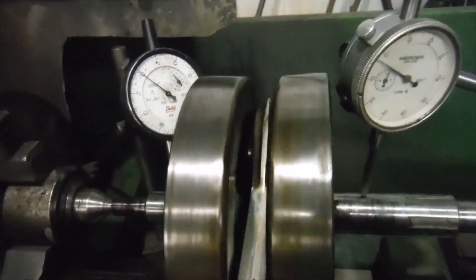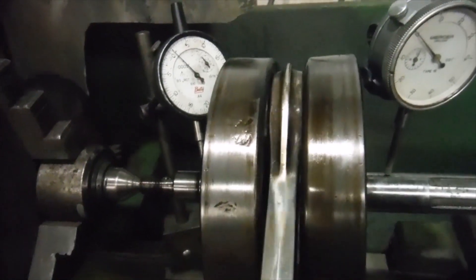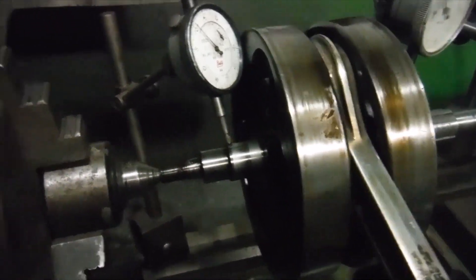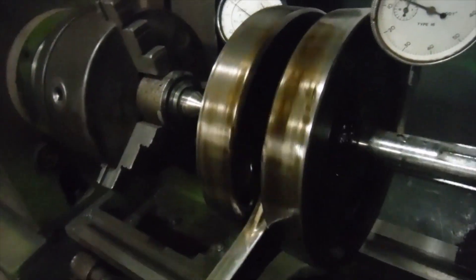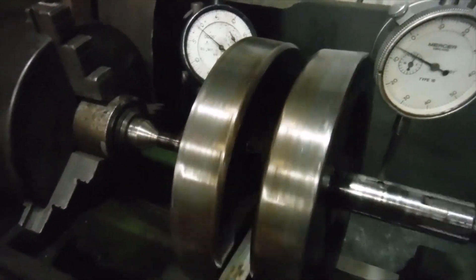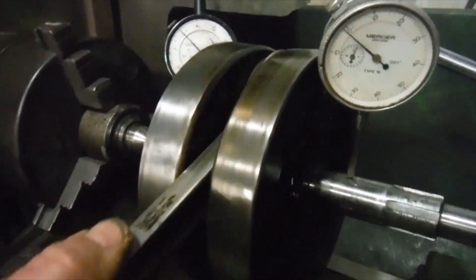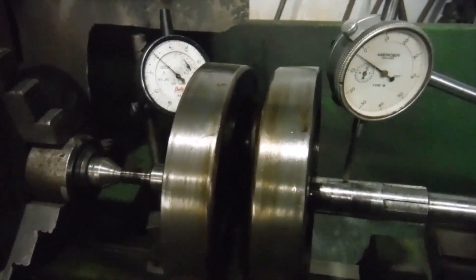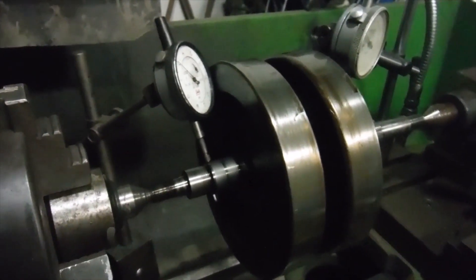At least I know I've got a point of reference now, and if I can do better than that to any degree I'll be pretty happy. My next job is to get this flywheel assembly out from between the centers in the lathe, get it split, and have a look at the big end. I'll also discuss with the owner whether he'd like me to lighten and rebalance the flywheels — I do it on most of the 500 engines and some of the 350s. I'll split the flywheels shortly and we'll see what state the big end is in.